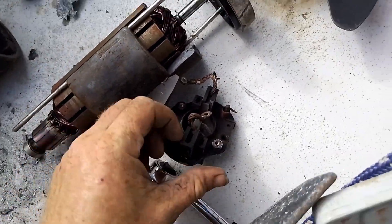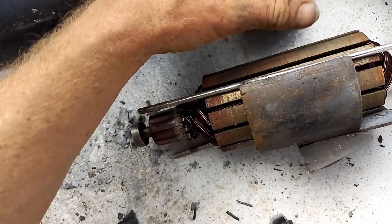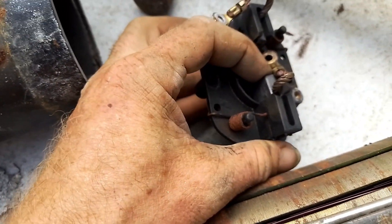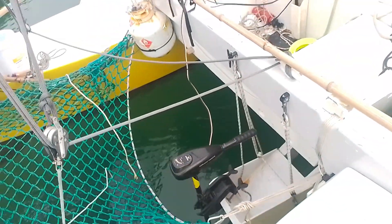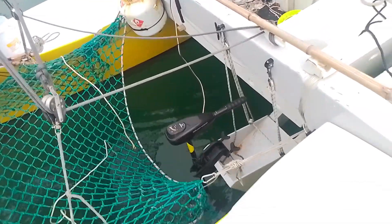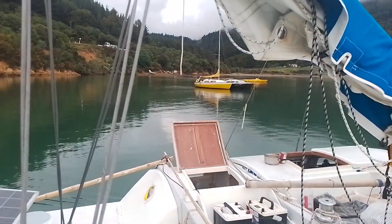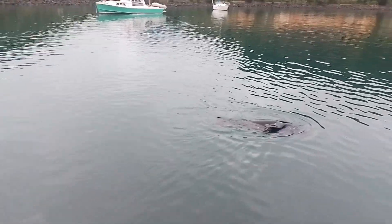The actual original problem was a spring that should be pushing the brush but wasn't. By the way, this is what the motor is meant to look like. I got it secondhand for $150 and had been using it happily for six months. Then one day it didn't turn on — it was actually only a small problem, but I turned it into a big problem.